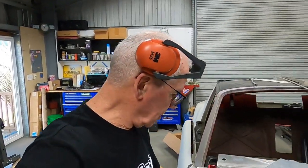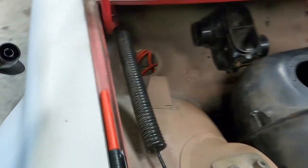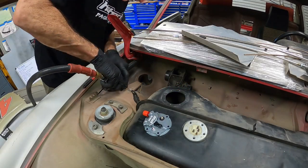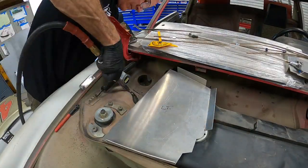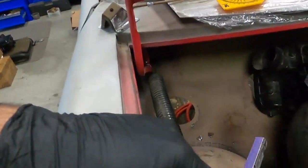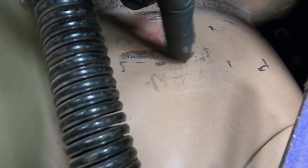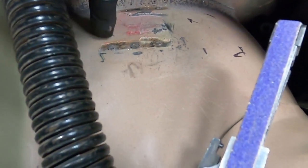Another all-over-the-place episode — now I'm going to work on mounting this fuel filter. I kind of want to put it in here somewhere, but I have to cut the factory piece out of the way first. It's the middle of a hundred-degree heat wave and this is not fun. The reason I like these belt sanders is you can sand down through the spot weld and leave the spot weld on the parent material, then come back and carefully grind that down without taking any of the parent material — other than a couple of little accidental spots, but those will disappear with sanding.